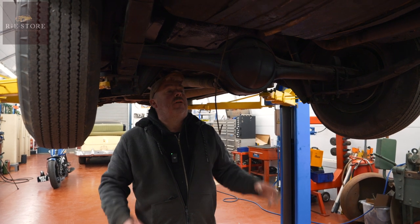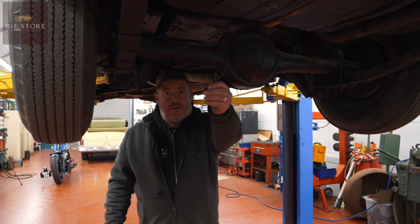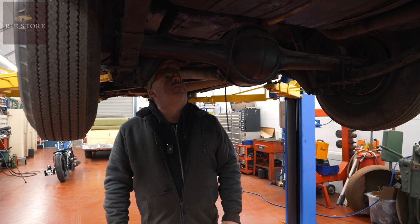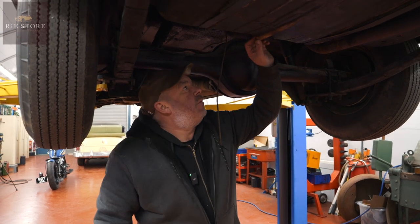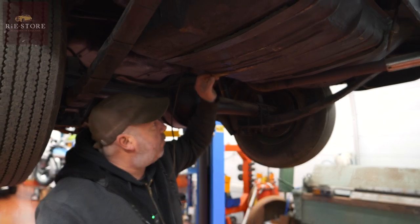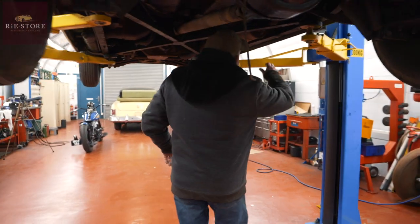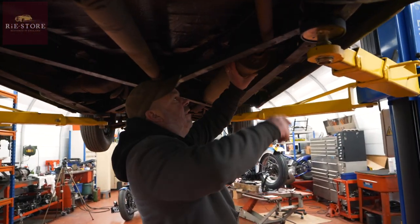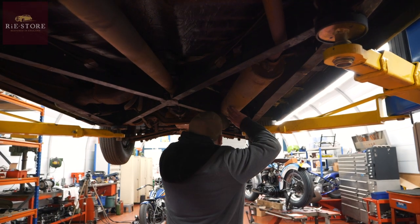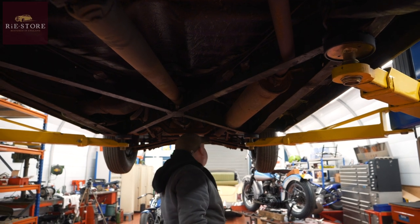The pistons get stuck in the slave cylinders. That'll probably be why the fuel gauge doesn't work too. We could pop it out and have a look. It's got a drain on it, but whether I'm brave enough to try and undo it I don't know, because normally it rips a big hole in them if they're knackered. The exhaust isn't done up there — that's all flapping around, hitting on the chassis. When you start it, it's blowing quite badly somewhere, so we'll have a look at that.